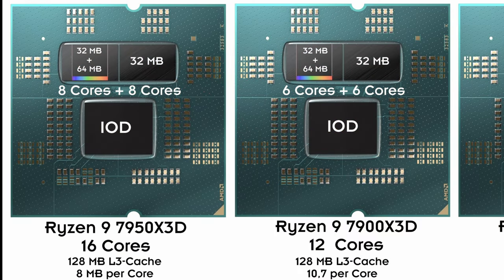One common question is: does a 7950X3D get that extra 64 megabytes on both chiplets? Unfortunately, no. As shown in a great graphic from Andre Schilling on Twitter, the 7950X3D only has that extra 64 megabyte cache on one of the actual CCDs — one chiplet. And from testing done by Hardware Unboxed, once a game starts, you're really only pulling from one chiplet to run that game anyway, so all that cache and game performance is coming off of one side of the CPU.